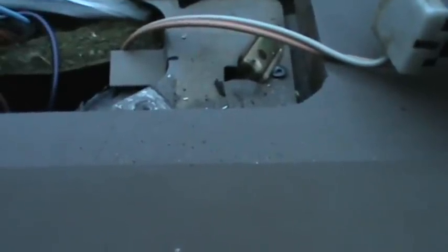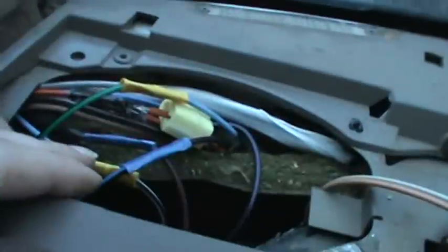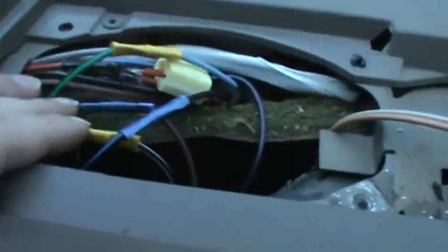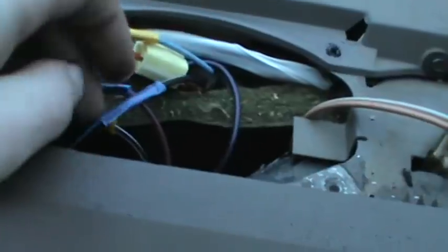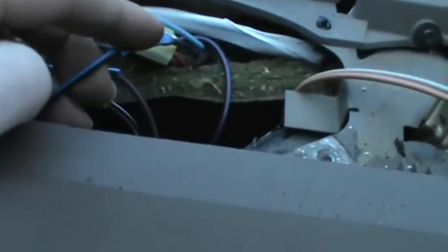The green wire goes to the other side, and that heads off to your passenger door. In my case it was a black and white wire that originally ran through here for the unlock circuit. The brown and black wire goes to the other end — there it is, it's hard to fish in here, but there's the brown and black wire from the Viper. This end of the black and white wire of my truck will be hot when I push the unlock button, because this is the unlock circuit. So the red and black from the Viper goes to that. Then this blue and black — this is again the unlock circuit, and this goes to the passenger side of that wire.